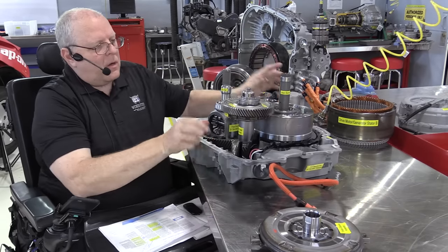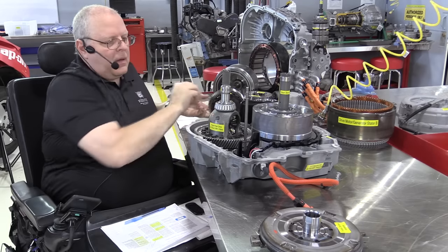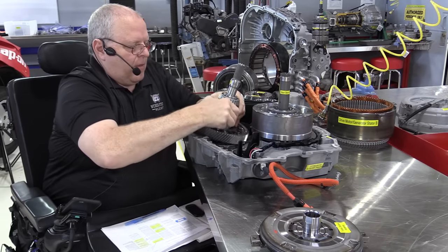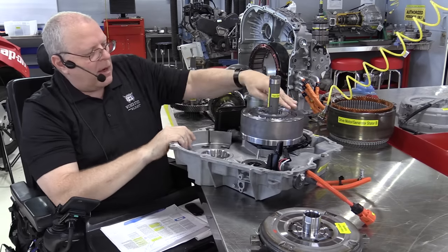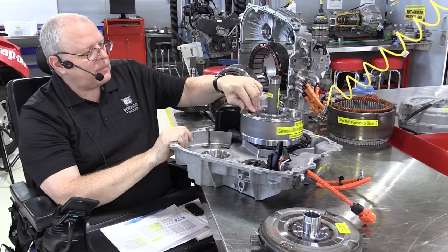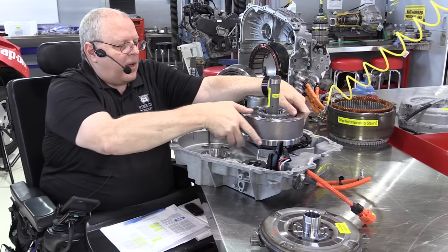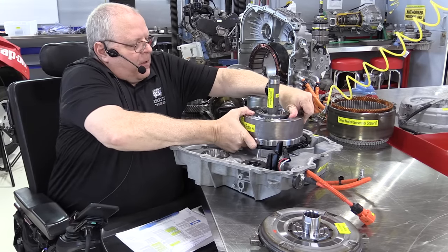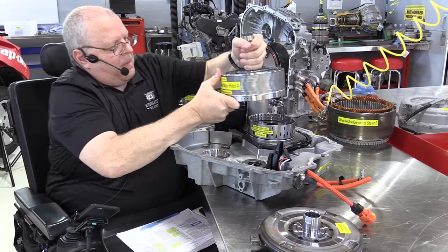the transfer gear. It has a lubrication pipe and the final drive. Get it off to the side here. And now we can see drive motor generator A. And notice when it turns this hub shaft, and we'll connect all of that together here in just a moment. But now let me see if I can lift this off of here. Here we go.